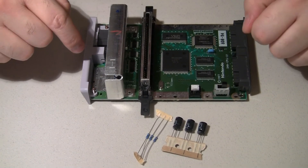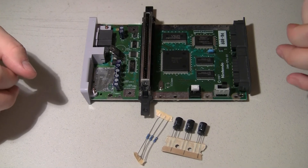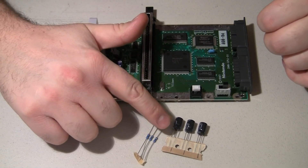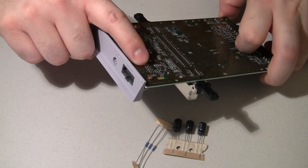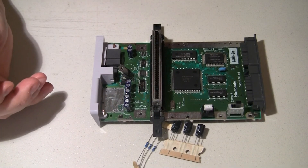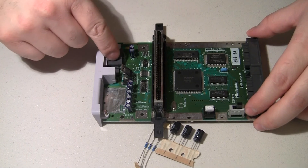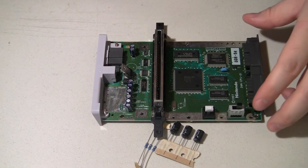So this is the motherboard — I have the heat sink loose — and I'm going to try a version of the mod that seems pretty easy. All it does is take red, green, and blue from the encoder chip which is marked S-RGB, then run it through a 75 ohm resistor and a 220 microfarad cap, and then route the wires under the board right to the multi-out connector pins. Since we're going to be using this on a Sony PVM RGB monitor, I don't really need to feed composite sync to the multi-out connector. The PVMs actually pull composite video as the sync, so running that wire would be redundant and quite useless.